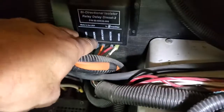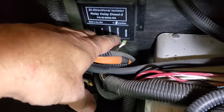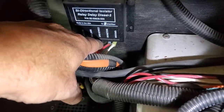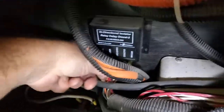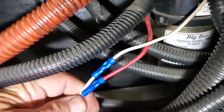So we get the wiring. It's ignition, and of course there's a ground, and there's the solenoid and the coach battery. That's the sense wire for the coach battery. The ignition is the B-plus to the module, and of course the ground is the ground. This one goes over - you follow these wires out - and right there is that big-boy relay. I know that this one is controlled by this right here.